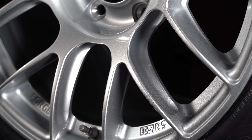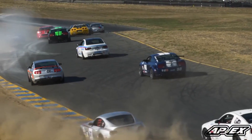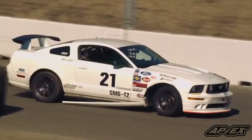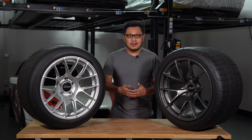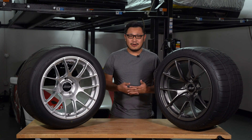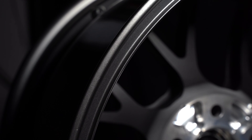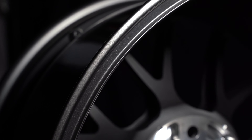What makes them so special is that these wheels could have been up to a pound lighter if we wanted them to be. So why didn't we make them as light as possible? Because motorsport wheels need to take abuse, and ultralight wheels typically aren't up to that task. Even though we didn't have to, we increased the load rating on these wheels for extra strength, which makes them a bit heavier. Even more uncommon is the extra beefy inner lip — we left over half a pound of material just to make sure it would reinforce that inner lip.